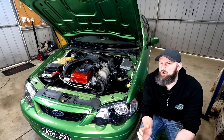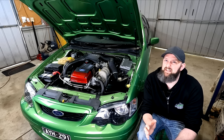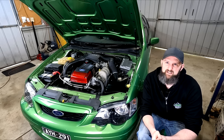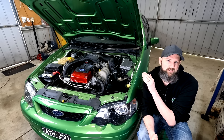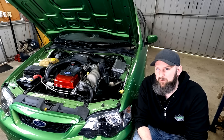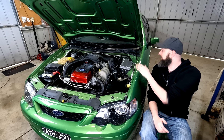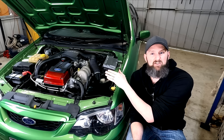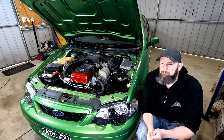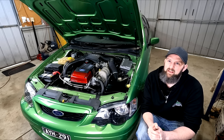We got close! I still think it has a 13 in it as is, and that 213 kilowatts was with the boost fading down to only 5 or 6 psi as we don't have a boost controller — so there's that. And the woeful 60 foot times still, thanks to the low stall converter speed and long first gear. So we could easily make good improvements on both those goals and likely will in the future. That's probably one thing I would add if I did it again — putting a boost controller in, or even go to a factory turbo ECU. Not bad for what is a completely stock NA engine though; it doesn't even have upgraded valve springs, and that's all with it running on 98 fuel. But for now I'm going to say that's a strike against us in the performance category.